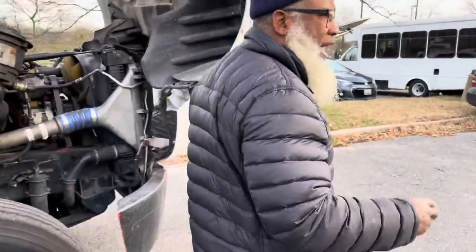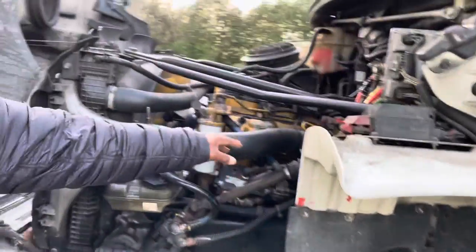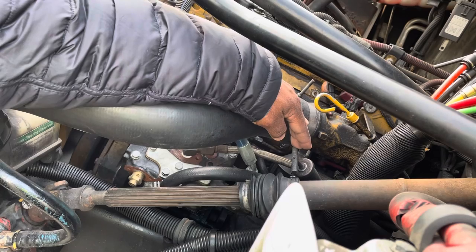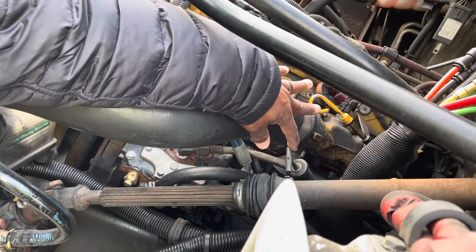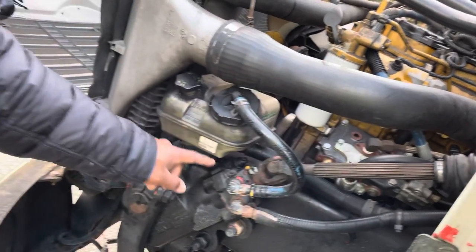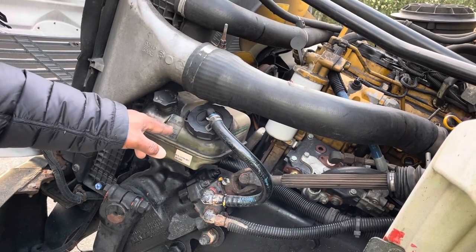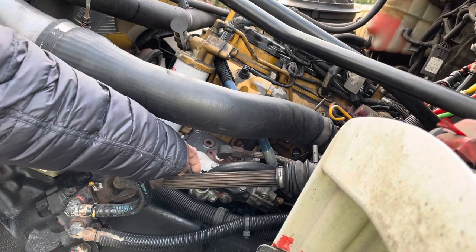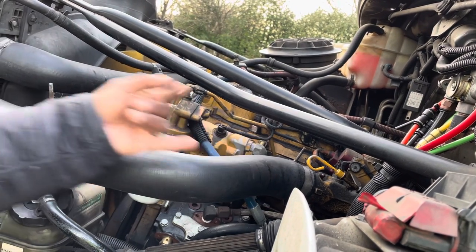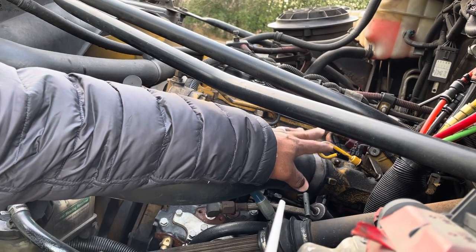Now to the driver's side. We have three systems: steering, braking, and suspension. Before those systems, let's get the loose components out of the way: the engine oil dipstick and transmission dipstick. The air compressor — underneath it is the steering pump. The power steering fluid reservoir and the gearbox. All these parts are not cracked, not broken, and secure — no leaks — and read between the add and full mark. The air compressor and steering pump are both gear-driven. To check the dipsticks: pull them out, wipe them off, insert them back in, pull them back out, and they should read between the add and full mark. You check the transmission with the vehicle running; you check the oil with the vehicle off.